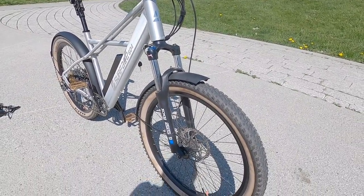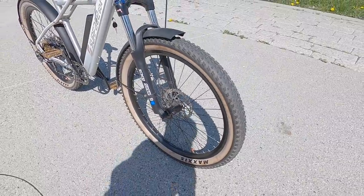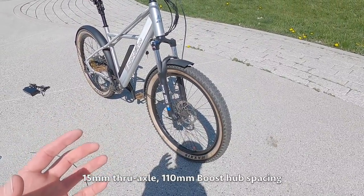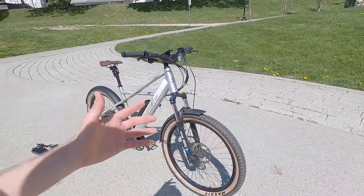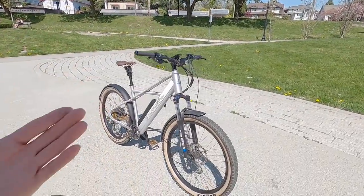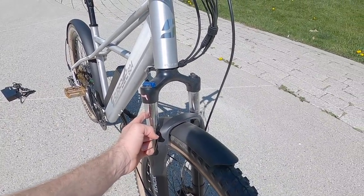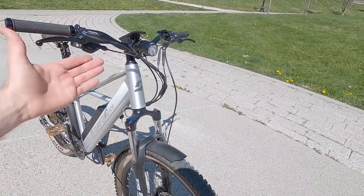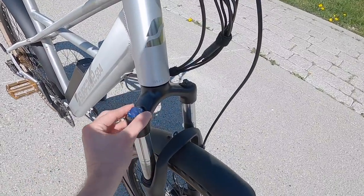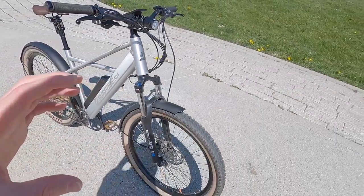You can take it off-road — it's got a nice 100mm suspension fork, the SR Suntour XCM 32, with a 15mm through axle, which is a really sturdy setup. The spokes are 13 gauge in the front and 12 gauge in the rear — thicker than the 14 gauge you often see — with 36-hole rims, so more spokes and thicker spokes. The "32" calls out the 32mm steel stanchions. This is not an air fork; it's a straight 1-1/8 inch steerer tube, not tapered. But you do get a lockout adjust to reduce bobbing for more efficiency, and you can preload the spring for your body weight.